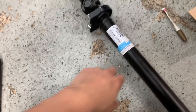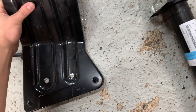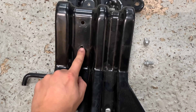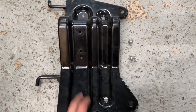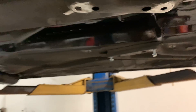You can actually upgrade to this drive shaft if you have a late '98. All you have to do is buy this center support plate, part number 9474483. You can see the center-to-center distance is actually smaller — it's two point twenty-five inches. You just have to drill this one hole up a little bit more, and that will allow the carrier bearing to bolt onto the plate no problem.